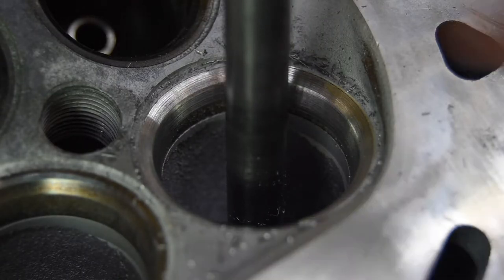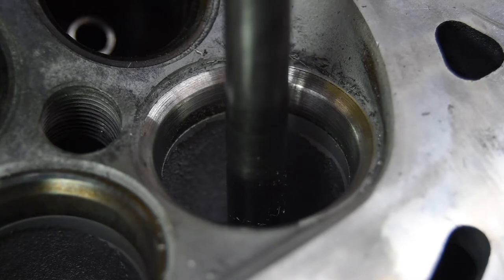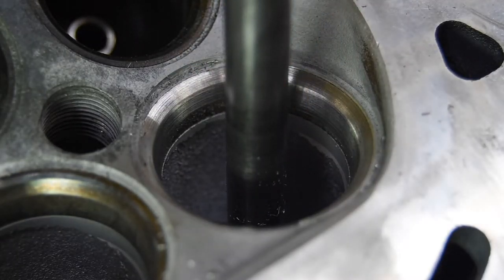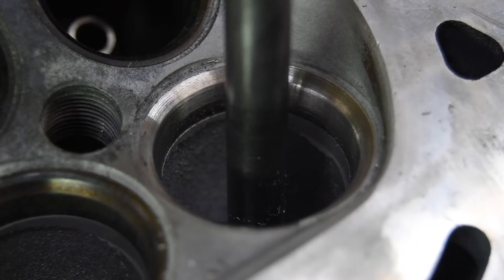So that's machining the seats. I just got one more to do, and then I got to do the exhaust, and they're going to go pretty much the same as the intake. And once I do that, I've got to set the valve tip height. So I'll bring you back when I get to that point. All right, see you later.